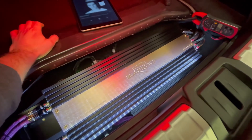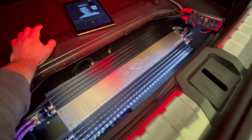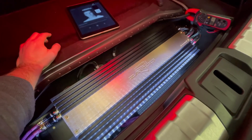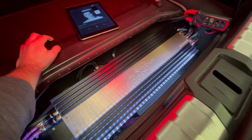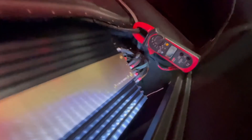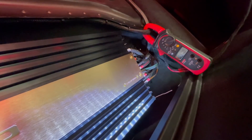It's pretty hard to see more than 60–80 amps on a Freeway with a sub. We also have rear fill with a two-channel amp but that doesn't draw anything. A friend has two Helix Q12s in a sealed box with a 5k monoblock on half an ohm — people would think you're going to kill those subs — but he's never seen more than 50–60 amps for the subs alone. The fact that you've got IB draws a lot less current as well. They are very sensitive in there — that's for sure.